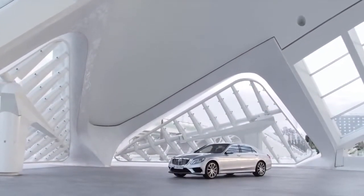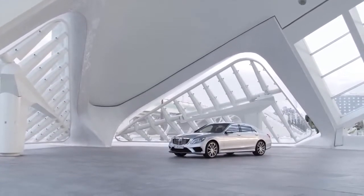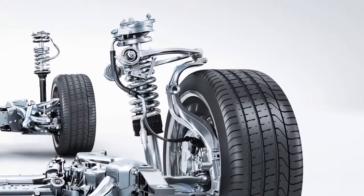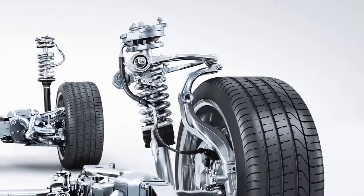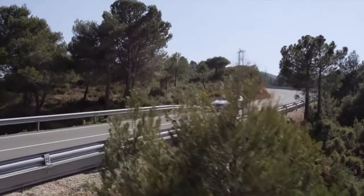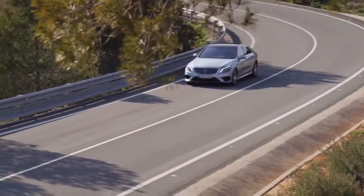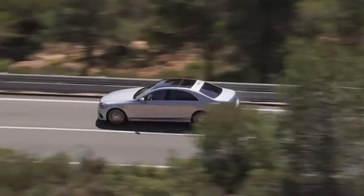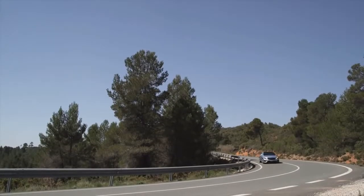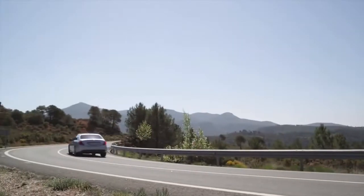The S63 is a full-size ultra-luxury vehicle that's also a performance vehicle. You want to carve the asphalt but you also know this is a full-on luxury vehicle. So in order to do that we have active dampening — a system of computer-controlled shock absorbers. Utilizing data from the vehicle including positioning, speed, and steering wheel angle, it can manipulate how stiff or how soft the shocks are. If you're driving through undulating country roads you have a beautiful lofty suspension which cushions everything. But when you want to get aggressive, all you have to do is drive aggressive and the car becomes as aggressive as you are.